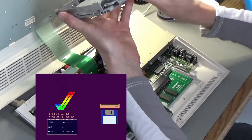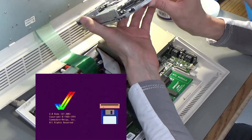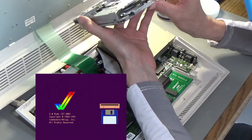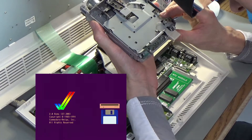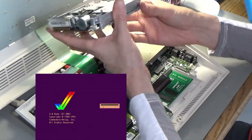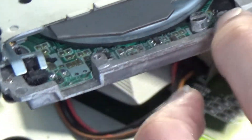It's weird that it's dead. I'm seeing a capacitor there — a surface mount one. If they're as dodgy as the ones in the Amiga, they would be failing as well. There's only one that I can see, but one might be enough. There is some gunk on the board. So maybe it could have a failed capacitor on there. There's a capacitor there that's got some gunk on it, so that could have gone.